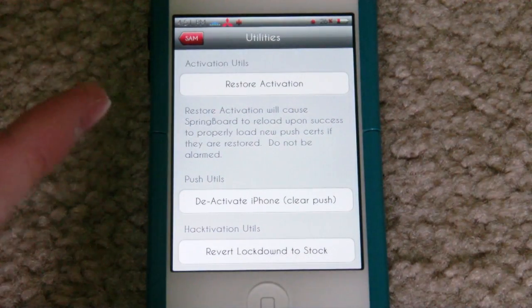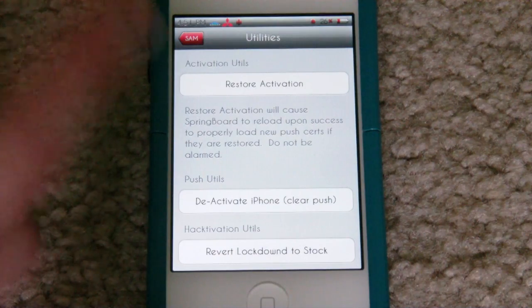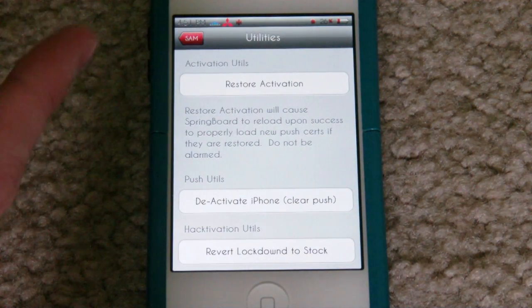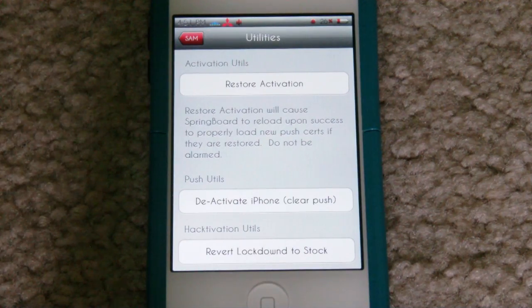At this point, once you've deactivated the phone you can eject the SIM card using your SIM eject tool or a paper clip just to get the SIM card out. If you guys don't know where that is on your phone, let me get the case off here for a second. You can see it right there on the right side of the phone — there's that little holder, you just put your SIM ejector tool in there and it'll pop out the tray. You can also use a paper clip to pop it out.